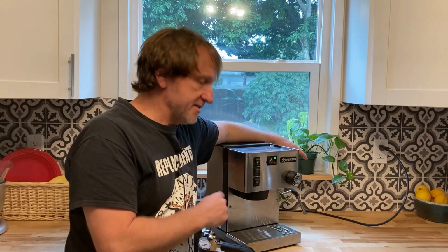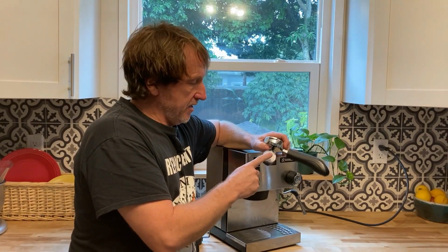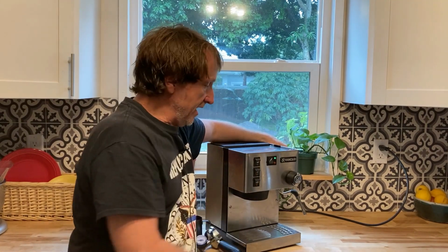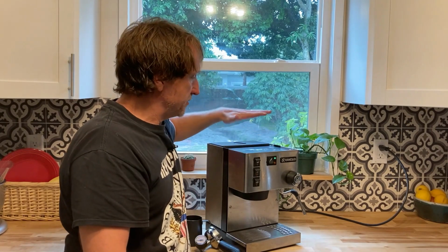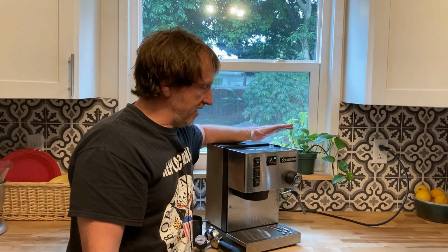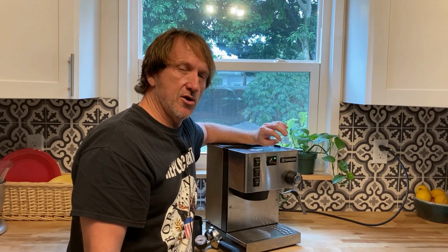My goal for today is to test this thing two ways. One, I'm going to use the pressurized portafilter test. I'm going to see how many bars of pressure that gives me. And then after that, I'm going to adjust by taking off the lid and doing it the other way that I showed in the OPV valve video before. I'm excited about the way that this is going to turn out. This is pretty well running shots right now, but as I noticed earlier, it may be a little under. And so maybe we get to adjust it and get it back where it needs to be.